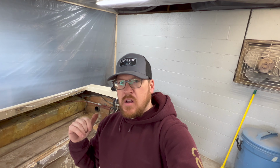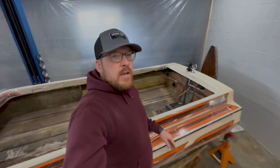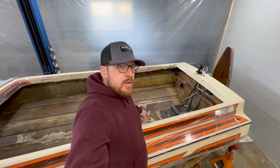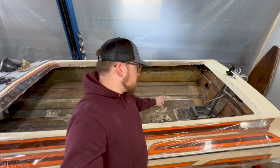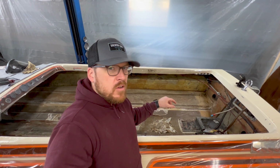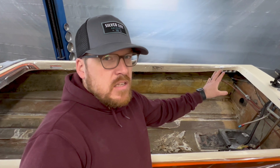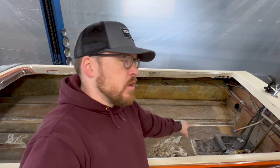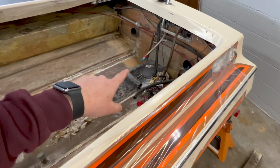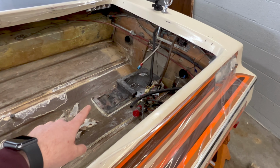Welcome back to Auto Technic and the third video of the jet boat series. Today we need to talk about the transom rot and what we're going to do to address it. In my last video, you saw that I cut the floor out of the boat and got the stringers out, and I initially planned on discussing the floor prep and getting everything ready for the new stringers in that video. At the end of the video is where I discuss the transom rot that I found and that we're going to do a hard pivot on this entire project. I need to get the transom addressed before I put the new stringers in.